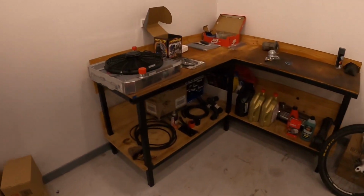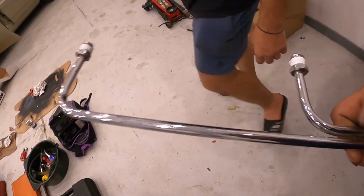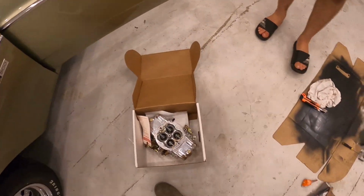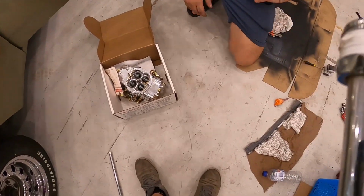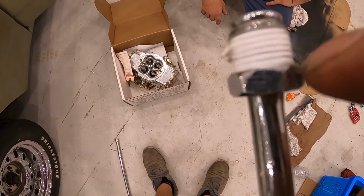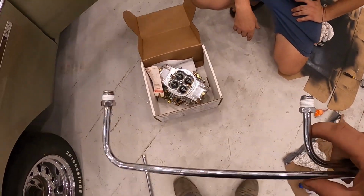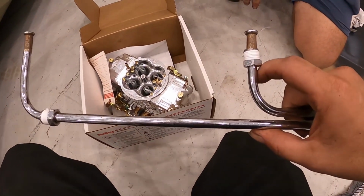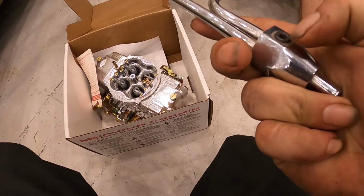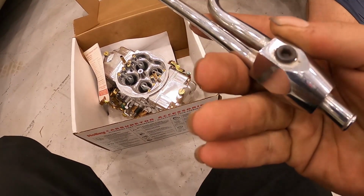We've got this prepped, ready to go. This is just a Holley chrome twin feed. Love it. You really shouldn't use thread tape on these, guys, because it can get stuck in the needle and seats, but we're so pro. If you wrap your thread tape so that the tail finishes in the direction of the thread, and you move it back off the nose of the bolt, just a couple of layers, it'll be perfect. What you really should use, if you're not competent, is liquid thread tape. Another thing that pays is to check this Allen key grub screw is tight, and sometimes put a bit of Loctite on there too, but we know this one's mint.